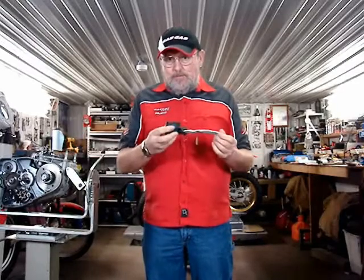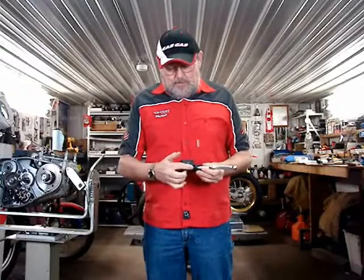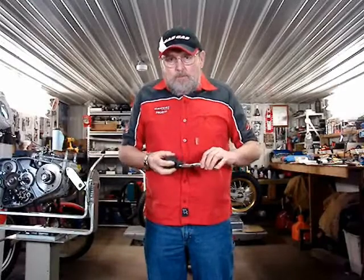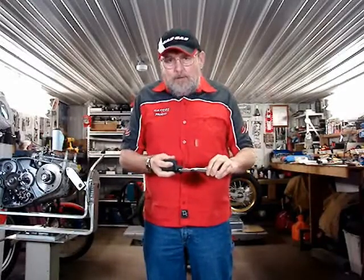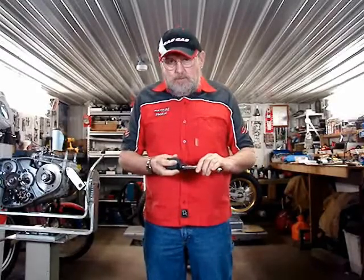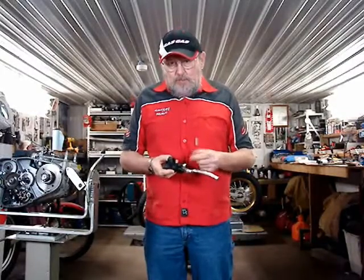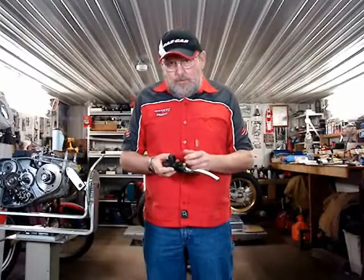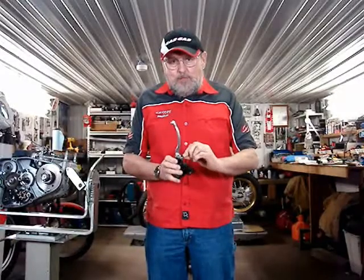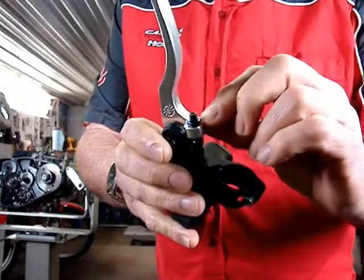But the master cylinder, the controller on the handlebar, that's a different thing. It has two adjustments. One is on the front here that adjusts the position of the lever in or out. Some people who have smaller hands want to move the lever in, or for a youth rider, that's all right, except that when you do that, you have to remember that there's an adjustment that sets the lever to the piston, which moves the fluid, and that's the one on the lever itself with the small 10 millimeter nut. I'll move in here and see if we can show that a little better.